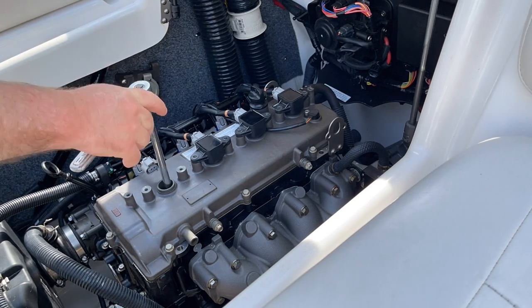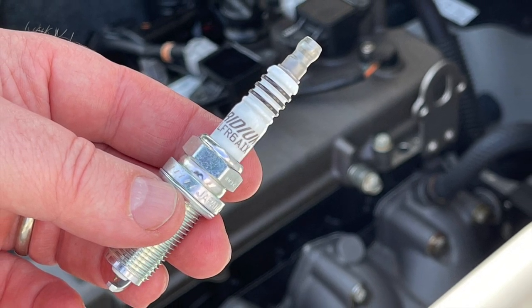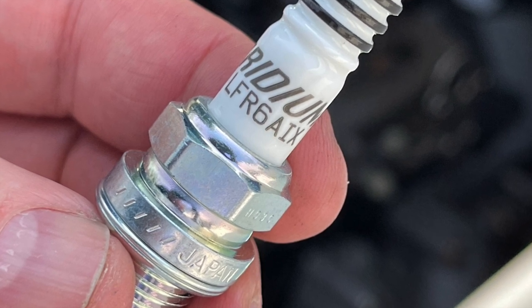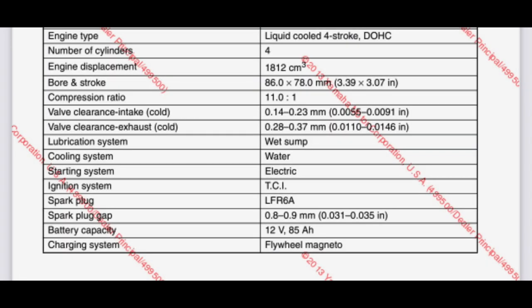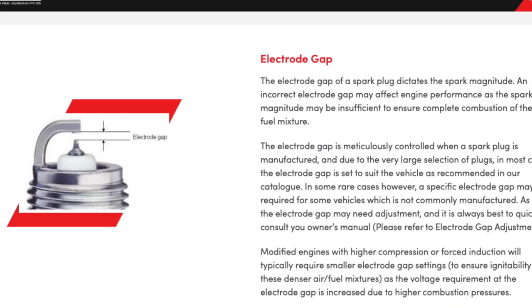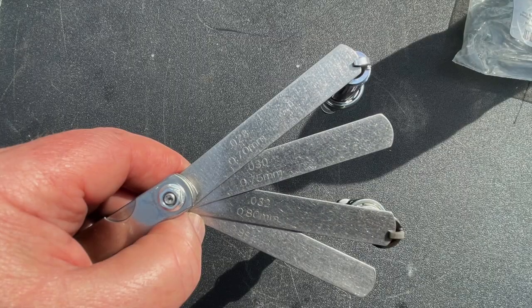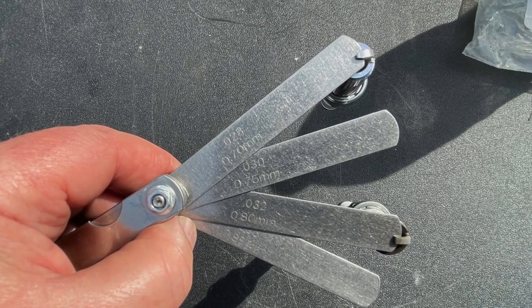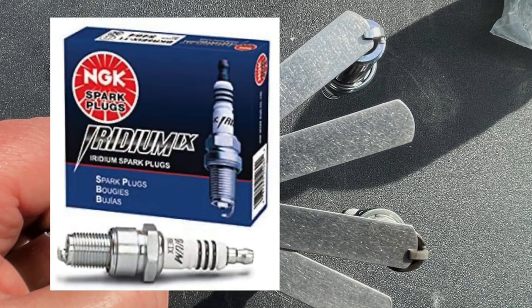It's time for phase two of our experiment. We pull out the NGK factory plugs and put in the NGK iridiums — same model plug, but with the iridium center electrode. When we look at that iridium plug design, the center electrode has almost a point to it, a little different than the copper core plug. Now, regarding gap: the factory plugs call for a 0.031 to 0.035 gap. I found these new NGK plugs pre-gapped at 0.028. I spoke to NGK about this — they recommended just leaving it at the preset gap, as the plug operates a little differently than the copper core plug.